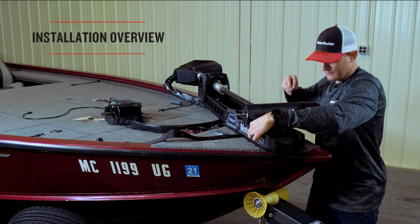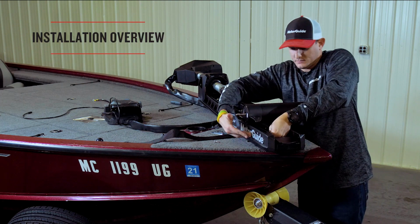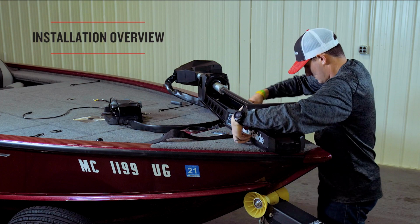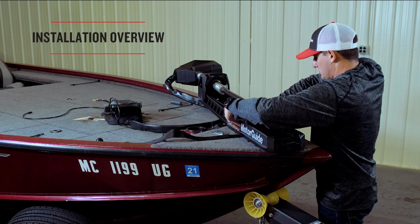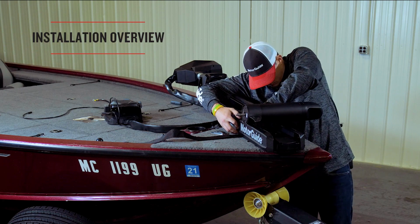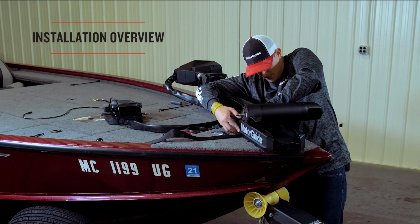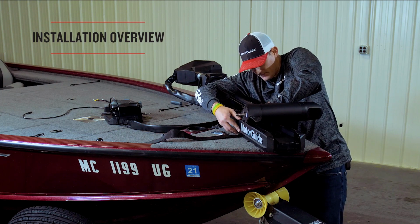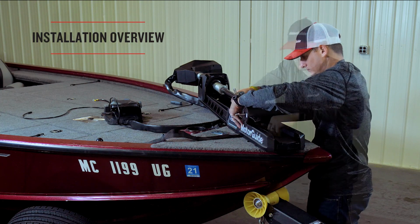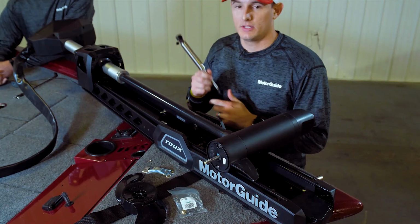We've got our 4 screws. We can get them started by hand. And then we'll finish it off with the T20 Torx bits that's provided in the box. Done. So now that we've got everything mounted up, we're going to go ahead and install our gas spring, which is located in our owner's manual bag or prop kit.